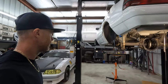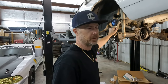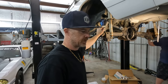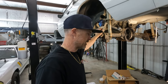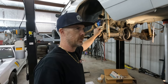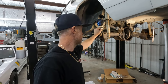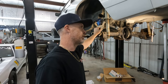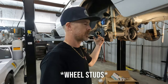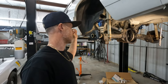All right, new day, new attitude — it's still a little negative after all our rigmarole. So the diff cover was on two times when it shouldn't have been. Number one, we were in a groove and Ricky said get the diff cover ready, so we put it on. He assumed Jerry was running C-clip eliminators, which he wasn't. So we pulled it off, slid the axles in, fit the brackets — but we forgot that Jerry got extended lug nuts and there's no way to run the lug nuts into the back side of the rotor with the plates on. So that was the second time.